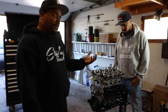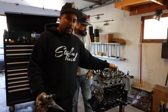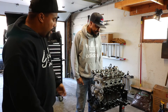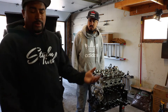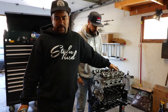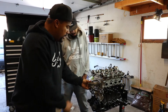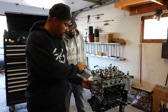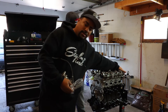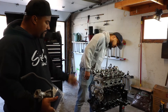So with the 1.6s, and I think even the 1.8s, the coolant reroute is really good because this rear cylinder doesn't get enough coolant. A lot of times what happens is this rear cylinder actually cooks. I hear from a lot of people who have blown their motors — it's always cylinder 4, it's always that rear cylinder. So the reroute is going to go from the radiator to the back of the coolant port from the rear, which is going to help a lot for that rear cylinder, and it also looks better.